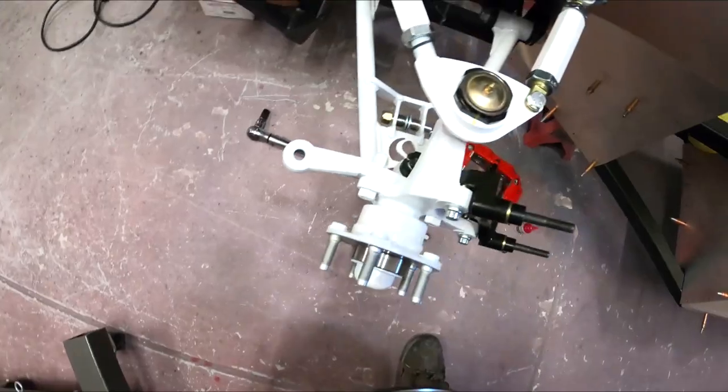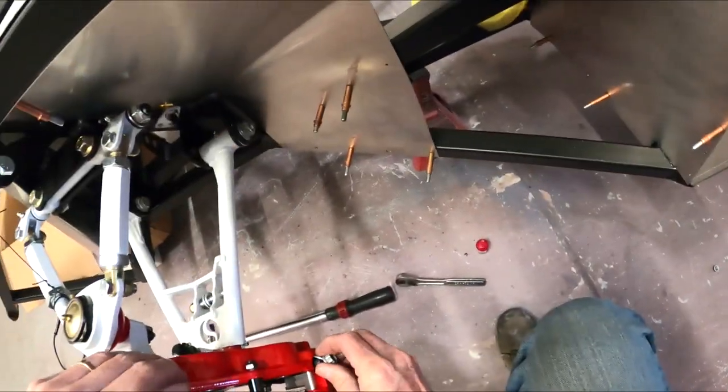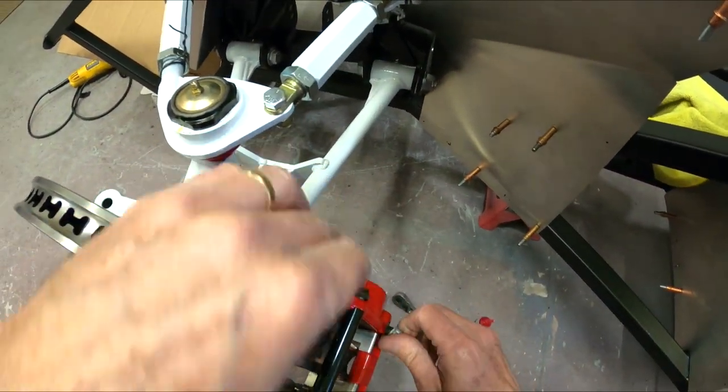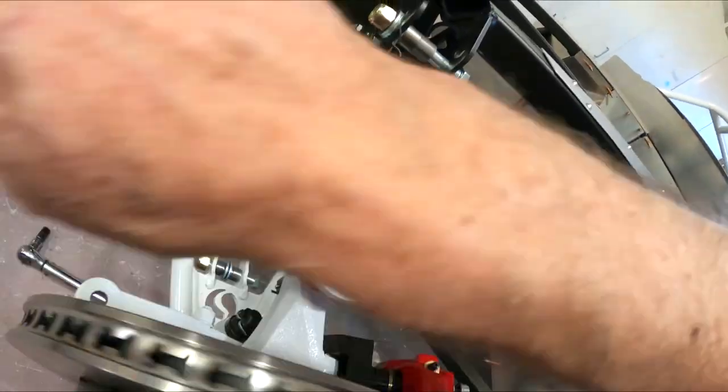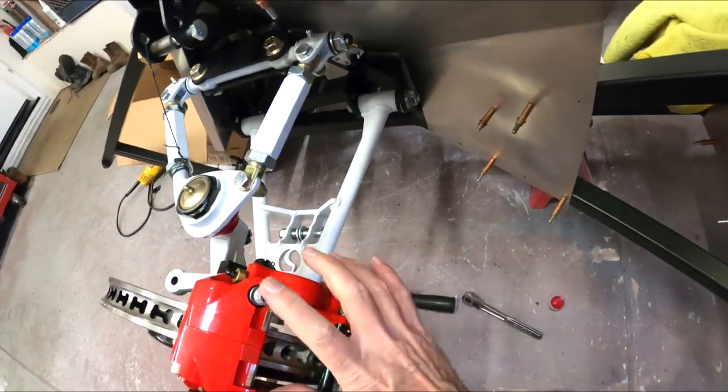Get the rotor on. As I said, we don't have a whole lot of space between here and here — it's tight. I had to put three of those washers or it was going to rub. To torque these, they say put some oil on here — no Loctite, I believe. Thanks for watching another episode of the Cobra Daytona Build. This episode we installed the big Wilwoods — Super Lights, six-piston, 14-inch by 1¼-inch wide rotors. Should be plenty. Thanks again for watching. If you like this video, please hit subscribe and we'll see you again on the next episode.